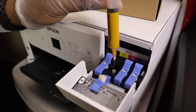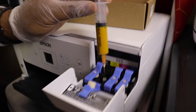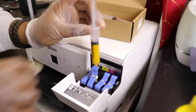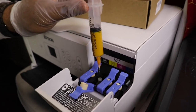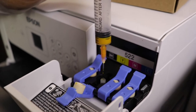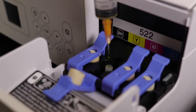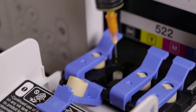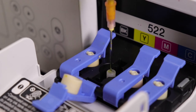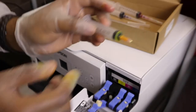This yellow one was the highest filled. If you look at the blue and black down at the bottom, they look about 75% full, whereas the red and yellow look about 80 to 90%. But again, the staining of the ink can really mislead you. We probably won't need to do red and yellow again next time. When you stick the syringe — stick it right over here in the corner, just press down gently, and just let it go. Do not stick it in there like you're trying to inject somebody's skin — people have probably done that and you will damage the tank. Just put it in there, let go, push it all the way over to the left, and then start pushing the syringe. That's it, guys.